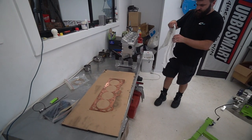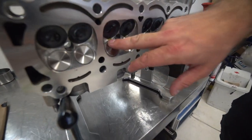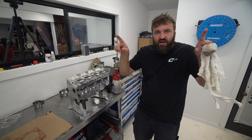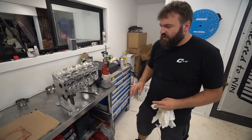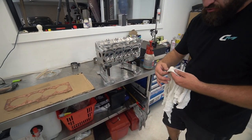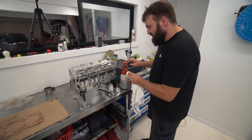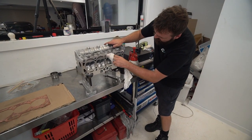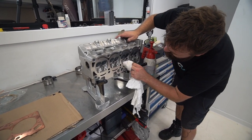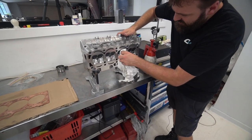Gasket's being cleaned, now move on to the cylinder head. Give that one more final go over. When I assemble these, I oil them up real hard, so you're going to see oil coming out from between the seats on the valve. If you don't wipe this out, when you drop the cylinder head on, the oil will leak down and hit the face as you're positioning the head on with the gasket glued. Any oil that leaks down out of head bolt holes is going to end up between the gasket surface, and it doesn't matter how good your glue is — if there's oil between it, it's not going to stick.